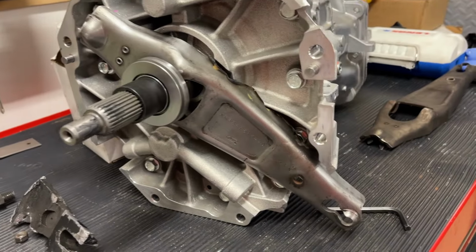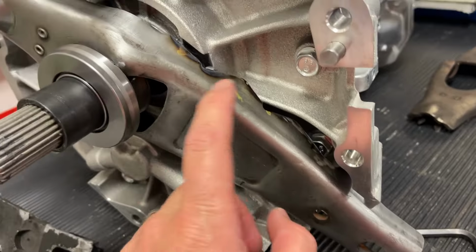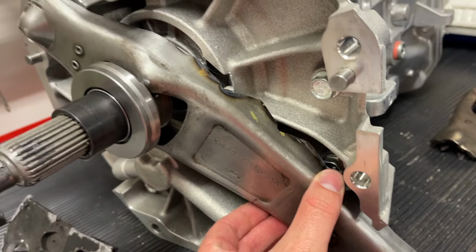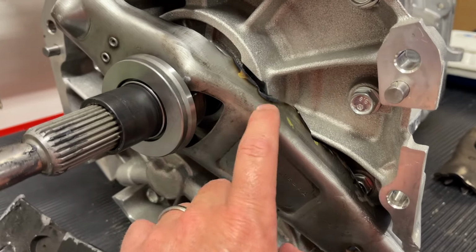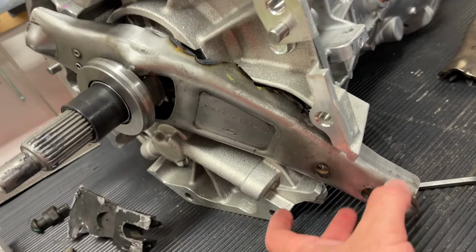Okay, another note on clearancing, even when you're taking this off of the backside here and you're cutting it so it's not hitting the webbing anywhere here, you're always going to be hitting a high point. So you'll grind it down, and then when you put this here, you might be hitting here, so you grind that down. Then the next thing you know, that's making a hit here or the other side. So just know that about the clearancing.